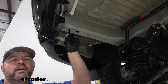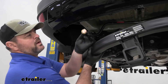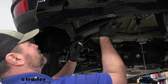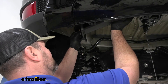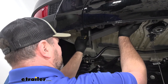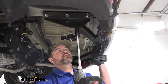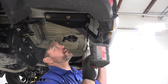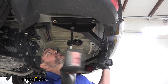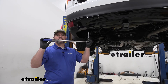We're going to have three on the passenger side and three on the driver's side. We'll need a next set of hands to raise our hitch up into position. For our hardware, we're going to take a hex bolt and conical tooth washer — make sure the teeth are facing up towards the hitch. We'll get one in place on each side to help support the hitch while we install our remaining hardware. Once we get all of our hardware in place, we'll come back with a 7/8 socket and tighten all of our hardware into place. Once tightened, we're going to come back and torque it to the specifications in the instructions.